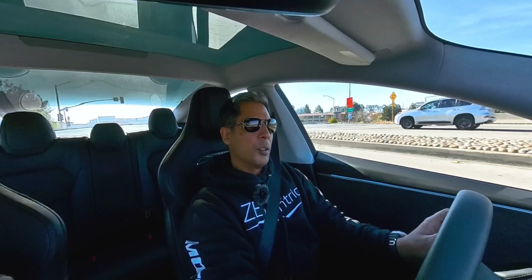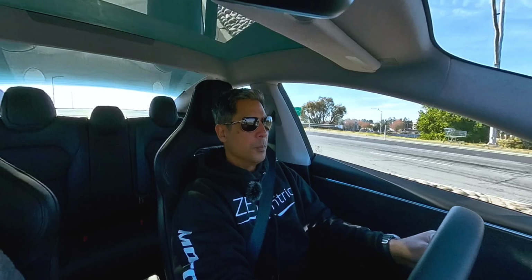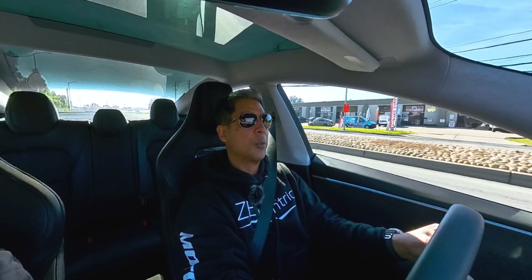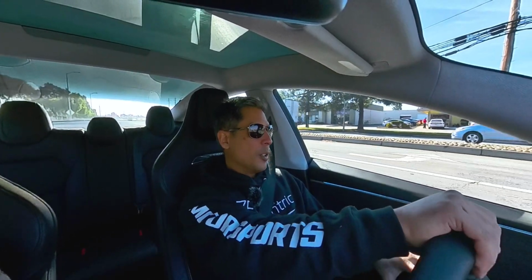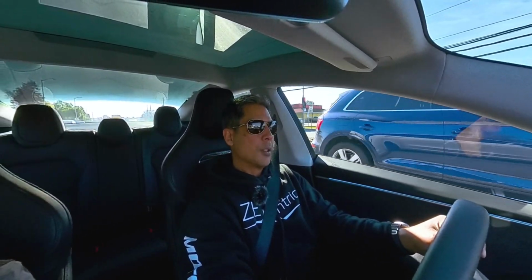The rotation, the weight transition, the steering is very responsive, which is really nice. On a lot of lowering springs, you actually feel the vehicle wants to understeer and push. That's not the case with whatever Mountainpass has chosen for spring rates on this thing. Now keep in mind, with those lower control arm bearings, it makes the steering really nice and direct, really sharp. So you don't have a lot of play and flex going on, which can also lead to some delayed responses in steering, some understeering.